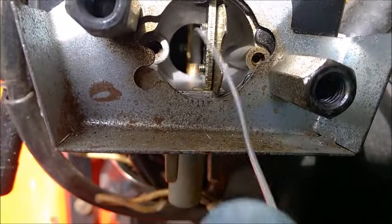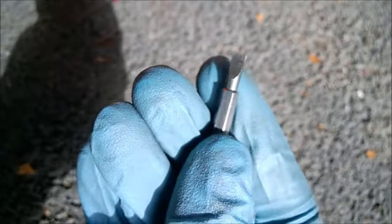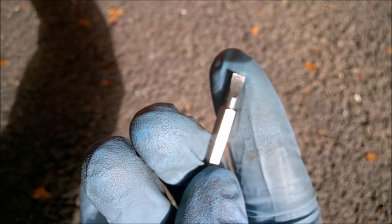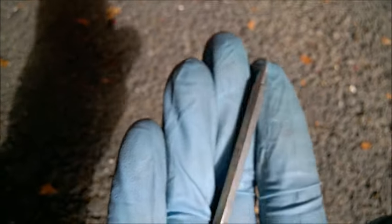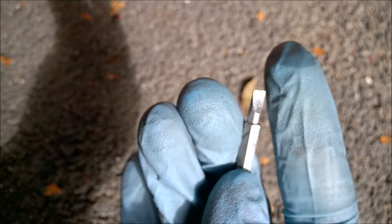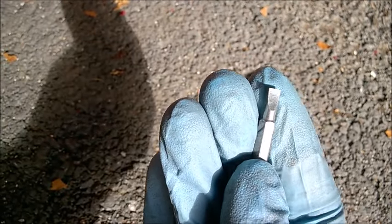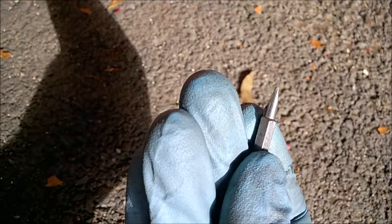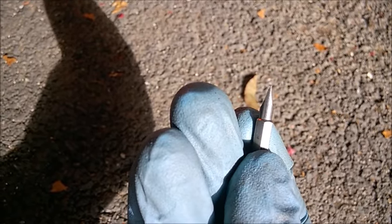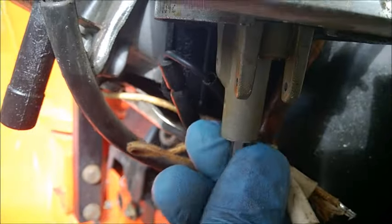Hopefully you get a really good image of it. Underneath, you have a small screw, and that screw takes a flat screwdriver. Unfortunately, the slot of the screw is really slim. This is the only screwdriver tip that fits — it's from a smaller screwdriver. The width is four millimeters; you cannot put more than four or perhaps five. The thickness of the flat tip is no more than one millimeter — you cannot put a thicker one.